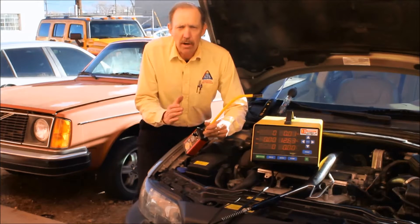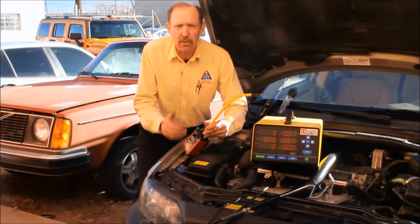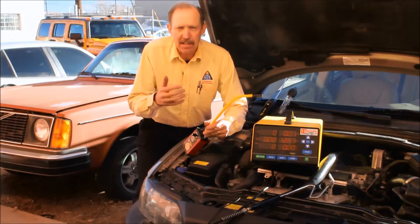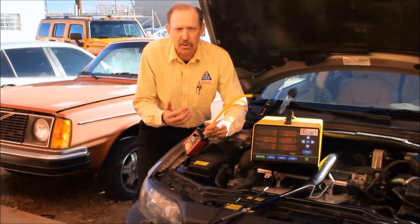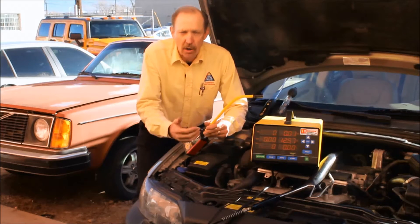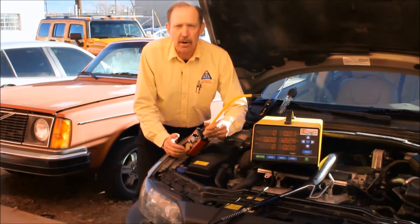What I want to do is check this cooling system to see if CO2 is in it. If CO2 is in the cooling system, that means combustion gas has gotten into the cooling system — there should be no CO2 in the system. That also means coolant can get into the combustion chamber, be burned, and go out the tailpipe with no visible sign — just the loss.